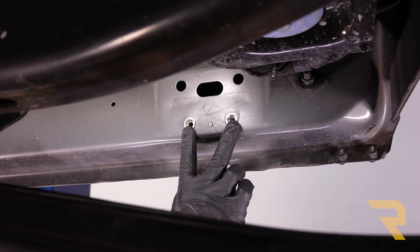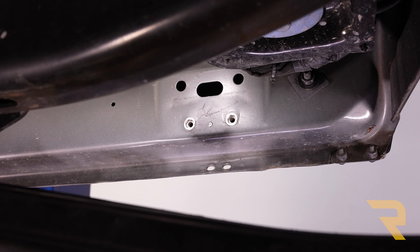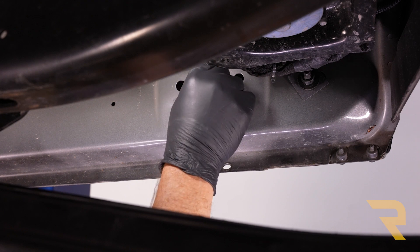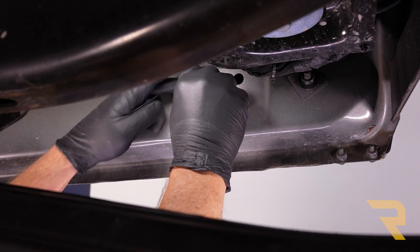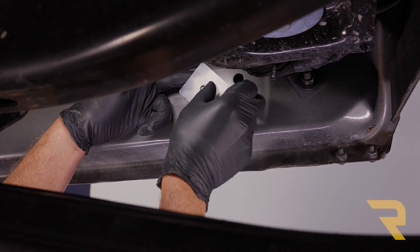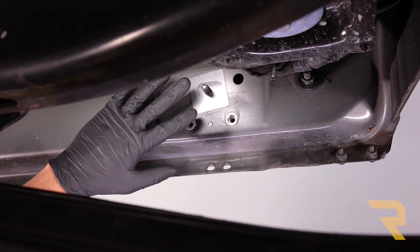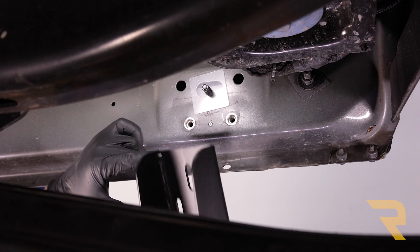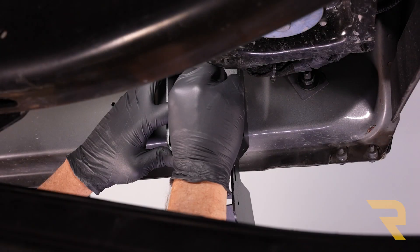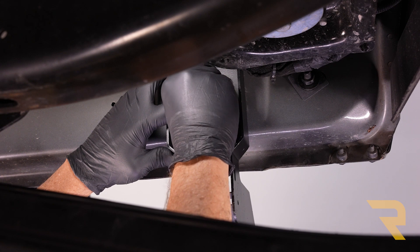We actually had a different set of running boards on here where we have the threaded holes. So if you've got threaded holes, the first thing you're going to want to do is take a bolt plate — just a single bolt plate — it's going to go into the oval hole. And once it's set up in the oval hole, we're going to set that in place with a retaining washer. That's just going to hold that in place while we put everything up. Now we've got our bolt plate held in place. We're going to slide it over top of that bolt and put a flat washer, lock washer, and nut on the bolt to hold that in place.